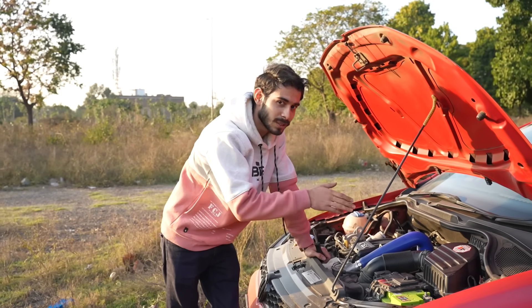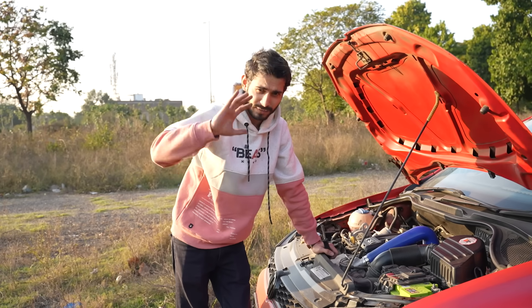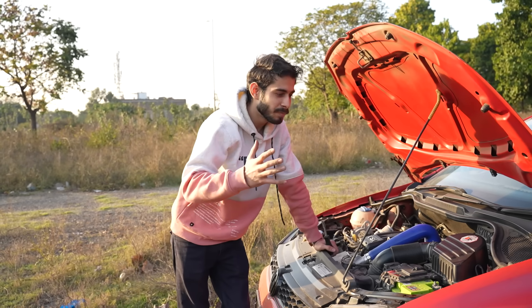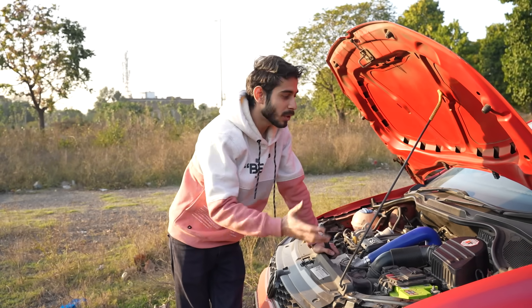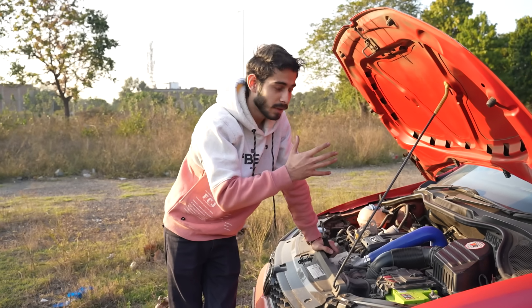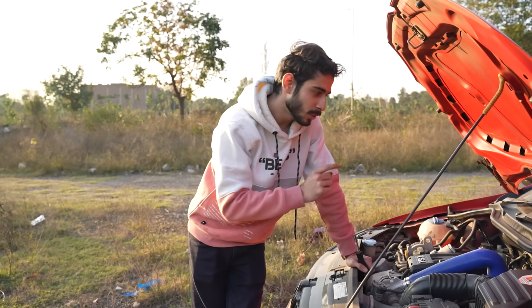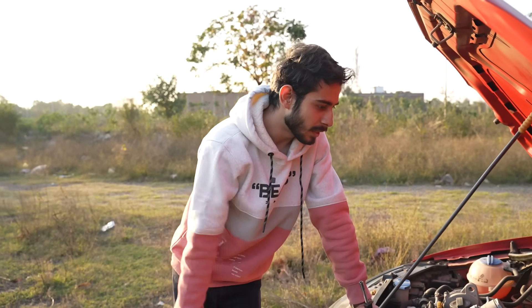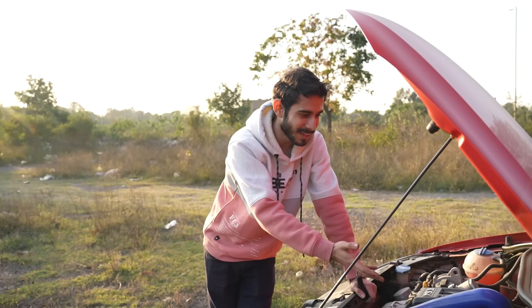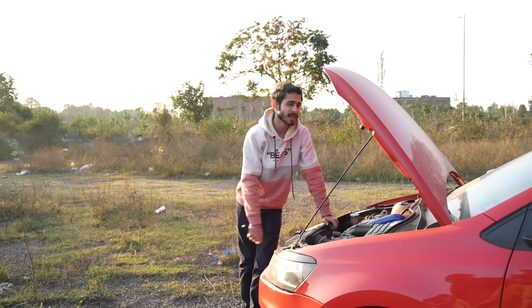It doesn't change the fact that your car makes a hundred horsepower. Just because the throttle body opens up a lot quicker and gives you that oomph — it just gives you the feeling of oomph. It doesn't even give you any extra oomph. It just lets you realize that this much power is available at your disposal, but you weren't able to use it because the manufacturer has set the ECU and parameters accordingly for a smoother driving experience. The throttle commander works as intended, but the people who claim it gains power for your engine — that it is equivalent to a stage one or stage two tune — it is not. If you have a hundred horsepower, you're going to get that hundred horsepower right away. In that sense, it is a scam.